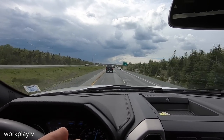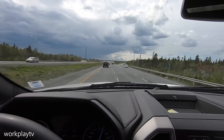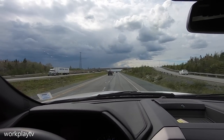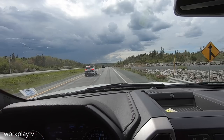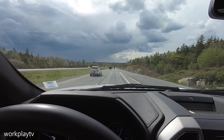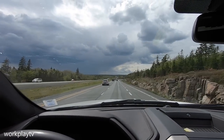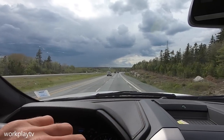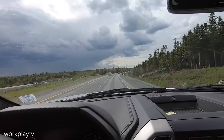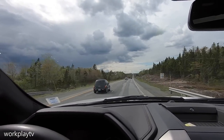I'm very, very happy because this is probably going to be the setup the majority of the time — this truck hooked up to this trailer hauling this machine — and it just feels fantastic. I definitely could put it in 10th gear and it would be cruising along no problem, but I like the RPMs where they are. I don't want to lug the engine. Keep in mind we've got 37-inch tires with the leveling kit on this truck hauling this like nobody's business. It just doesn't even care.